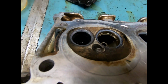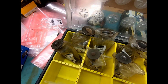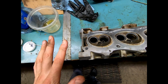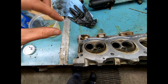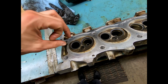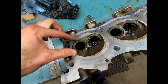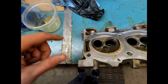What I am going to do after this, so I take each valve matched to each cylinder, and I line the valve with that valve grinding compound. I literally separate my hands. Left hand is the compound hand. So I brush some on the valve, hold it out, set it in, use my right hand to put oil on it, use my right hand on the drill, and only use my left hand, with a glove, to touch the compounded surface in and out.